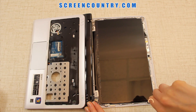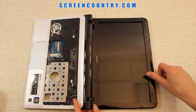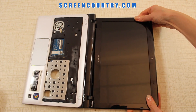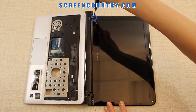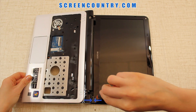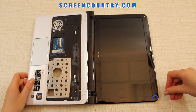Replace the 4 small frame screws. Put the bezel back on: snap the hinge covers at the bottom first, then go around the perimeter towards the top. Replace the 4 bezel screws — the bottom right one is tricky, so place the screwdriver in between the hinge cover and the plastic bottom part. Put on the screw covers.